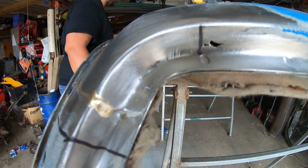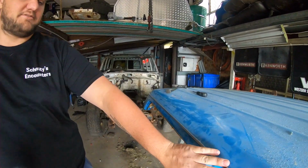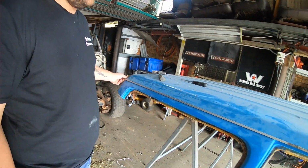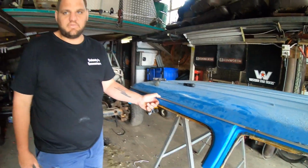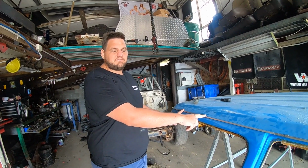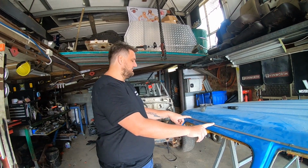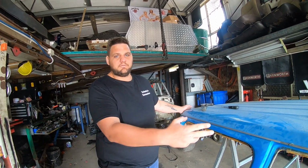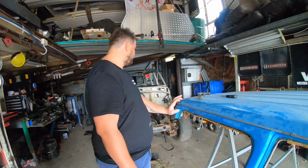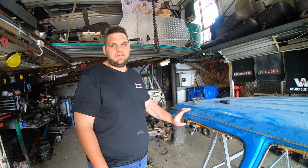We'll also be taking the rear corner, so we'll take the gutter from here in and around the corner, because if I can help it, I will, instead of putting a small patch, which is no matter how hard you try to hide it, you'll always be able to find it and see it. I'd rather replace it with a full piece of skin, and we will replace the structure in Pam's car from about here back into the corner where hers has been compromised.